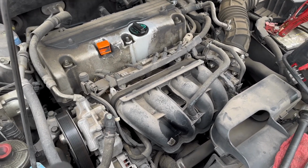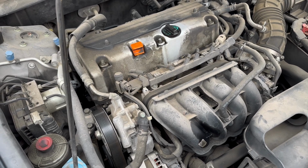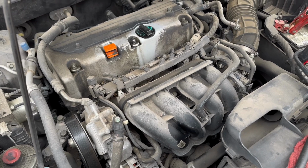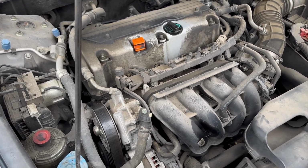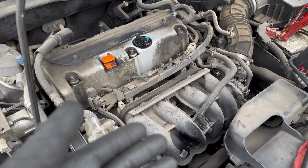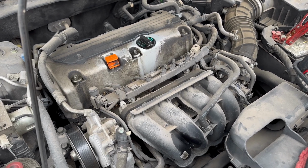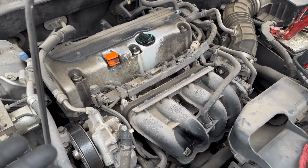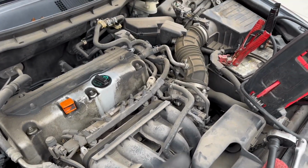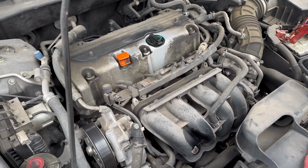Believe you gotta remove the intake on these to do a starter. I've never actually done one. But I'm gonna go ahead and go with my magic 8-ball here. And we'll go ahead and say we need to start with the starter. Maybe if I get approval, I can pull the intake, verify no voltage drop at the starter. And we still had that crank sensor code, so if we actually get it to start cranking, we could have been to another problem. Could be multiple problems. Get that battery cleaned up, recharge terminals, and then we'll go from there.